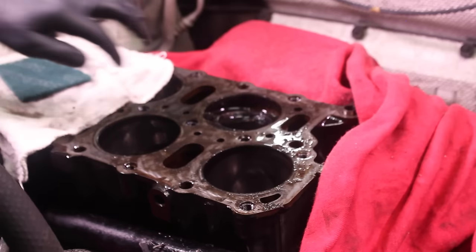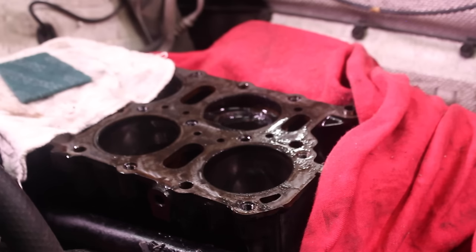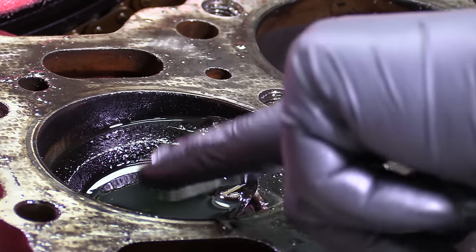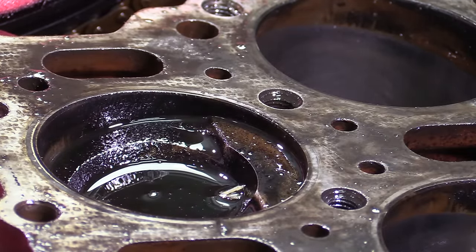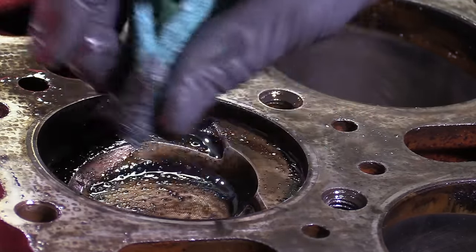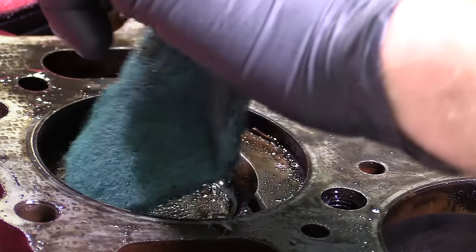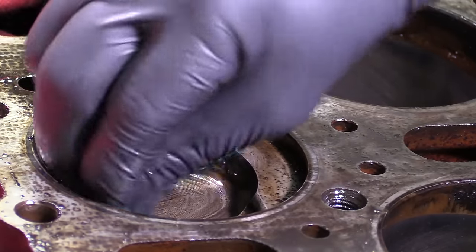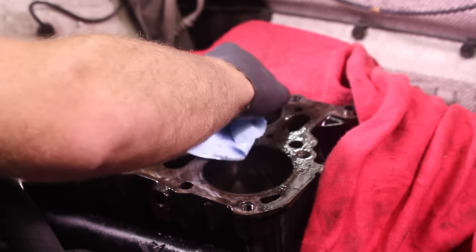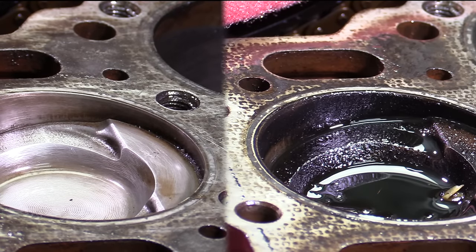Hit it with another spray of WD-40. I'm not going to worry about getting any WD-40 down in the cooling jackets because all that's going to get cleaned out once we have the engine on the stand. Now that we got the process started on the block surface, I'm going to let that sit to help break up any more carbon and I'm going to start on the piston and cylinder wall. Kind of the same thing — give it a spray, you don't need a ton, and this is where elbow grease is really all you need. You do want to be careful not to spend a ton of time scrubbing in one spot, as that can lead to removing a little bit of the cross-hatching. All you really need is some light pressure. You'll see the carbon starting to come up pretty easily. If there are any big chunks you don't feel comfortable with, take a blue shop towel and just wipe them out.